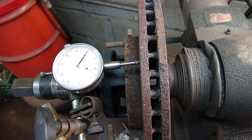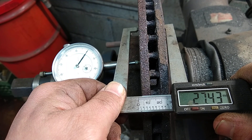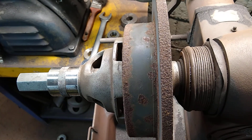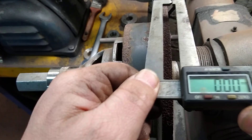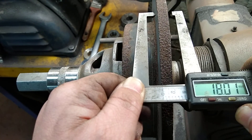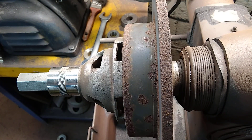Remember this is the minimum — the lowest you can go — 25mm. When we measured it in the beginning it was 28mm and change. So let's see how much we took out: it's 27.44mm right now, so we took out about 0.56mm — still well above the minimum specs of 25mm. Perfect. Let's check the other one. This one has a minimum of 10.5mm. Let's see how much it is right now — it's 11.16mm. Perfect. So this can go back in the car. Maybe one more cut and that's it for this one; the other one probably has two more cuts.